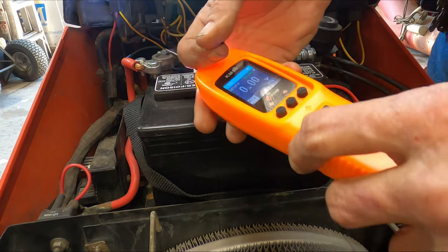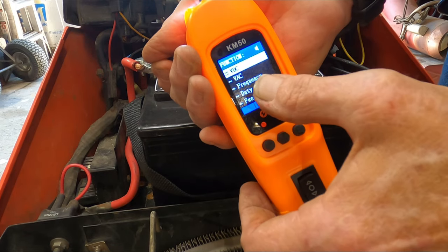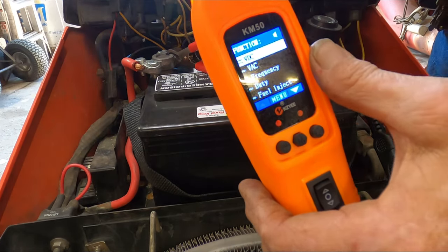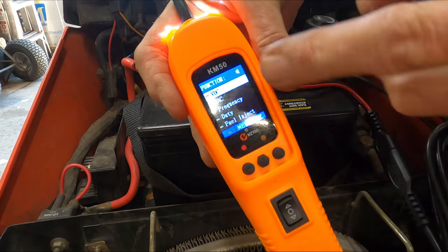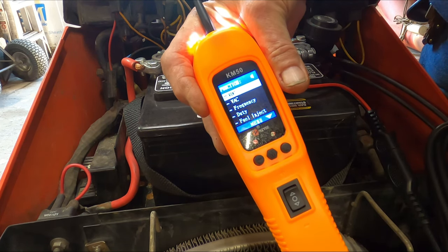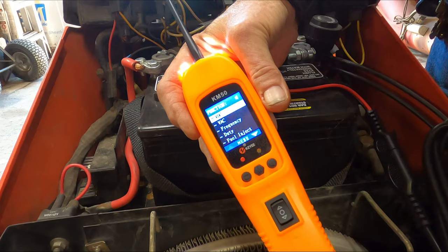Your different modes — right now I'll put it on there showing 12.58. Now we'll go to memory. This allows us to go up and down and select Volts DC, Volts AC. The Volts AC is not household current — a lot of fuel injectors and stuff like that on automobiles run a low-voltage AC, and that's what this will measure. We can measure AC voltage at the stator wires coming out of the stator going into the regulator rectifier, which is what we'll do to show the waveform.